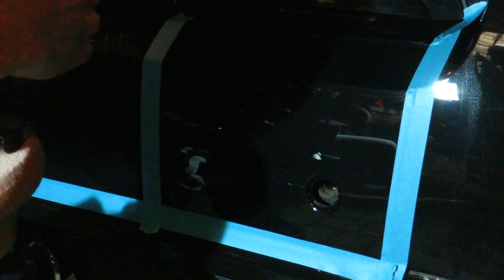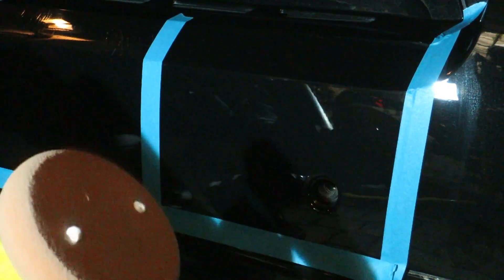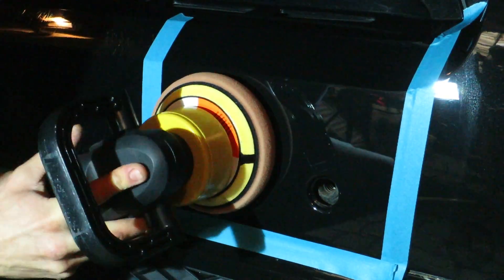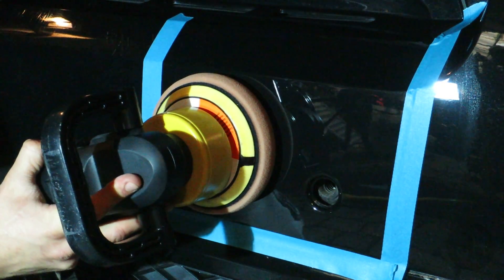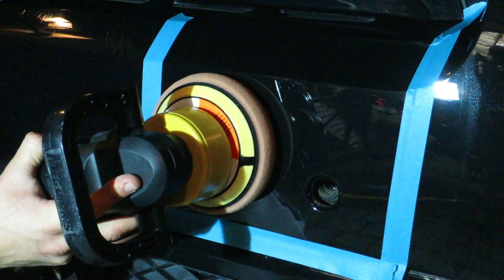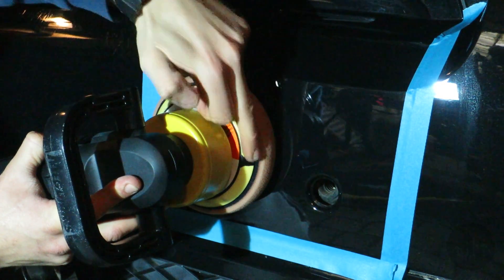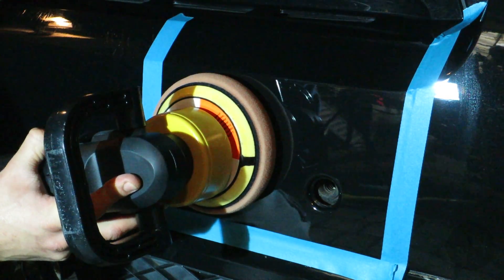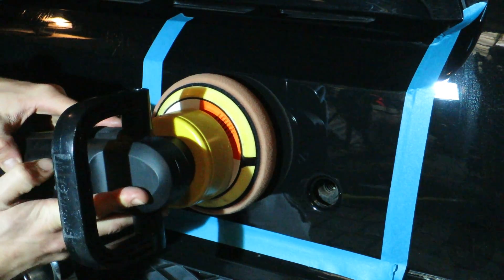Because it's been pre-seasoned, just two small pea-sized drops. Start the machine — that's set on one — on the paintwork. Once you've got your machine comfortable to use, just raise the speed and the pressure until you see it rotating one to two orbits per second. On this machine, it'll be about speed setting three to four.